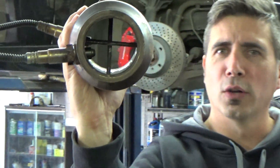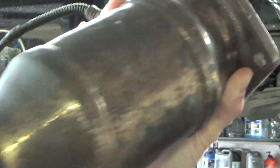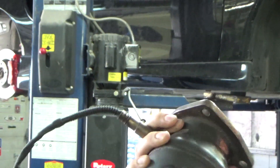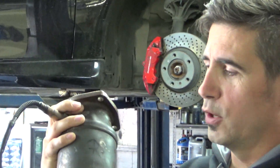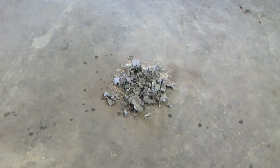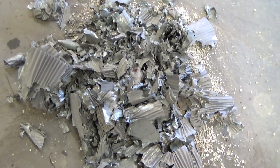After all that boring and drilling, this is basically what you have — a hollowed-out catalytic converter. There are two of these in the 996 turbo. Now, because of this, your O2 sensors would not work and you'd have a CEL fault code if the ECU wasn't flashed properly. But because the ECU has been flashed, it will basically ignore the signal from the catalytic converter. At the end of drilling out those cats you end up with a pile of rubbish — that's really all that was inside the cat.